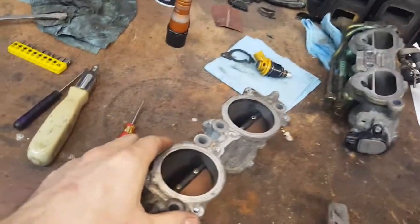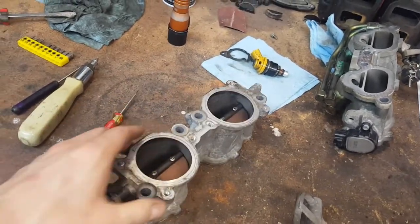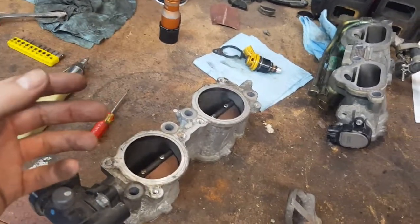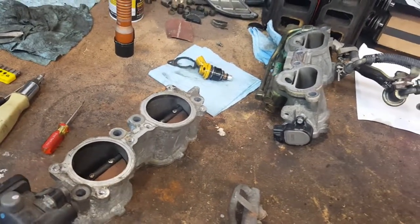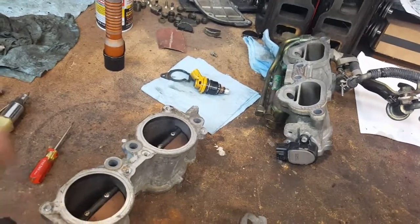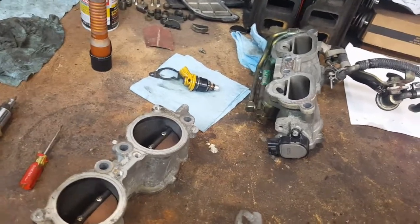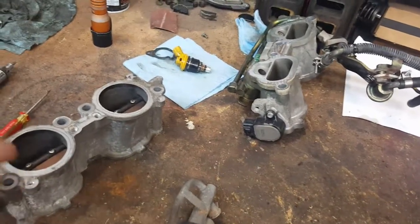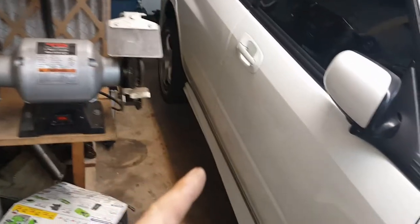A lot of times when these steel bolts sit inside an aluminum body and you go to take one out and it doesn't want to go, and it doesn't matter if you're gonna spray half a gallon of PB, heat it up, go in and out slowly, the thread's gonna strip. You're just gonna be lucky if you take the whole bolt out, so you don't have to drill it out. When I did the caliper, the front one, I believe, did come out. The rear one broke. I ended up drilling it out. But both helicoils seem to be holding up.